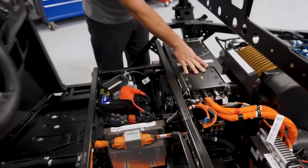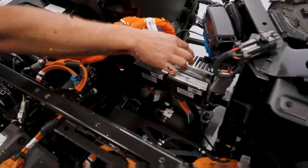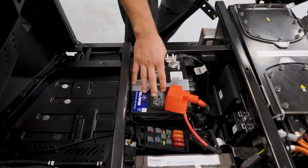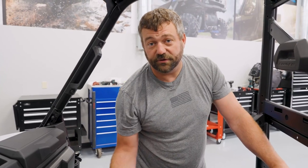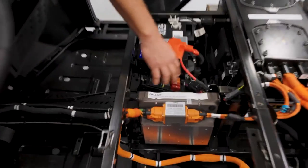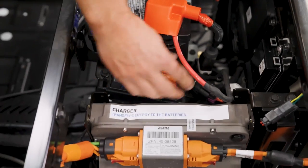From here we've got power coming out at 100 volts. You can see there are a couple of black boxes labeled DC-to-DC converter with a giant fin heat sink on the back. What those do is take the 100 volts off the battery pack and drop it down to a normal 12 volt, actually charging this battery right up here underneath the passenger's left thigh under the seat. This 12 volt battery is the same style you'd see in any gas Ranger, and it provides power to standard loads like your tail lights, headlights, gauges, power steering unit, and the 12 volt outlet in the back box. All the 12 volt protection — standard relays, fuses, and some bigger ones for the DC-to-DC converters — is here underneath the seat.